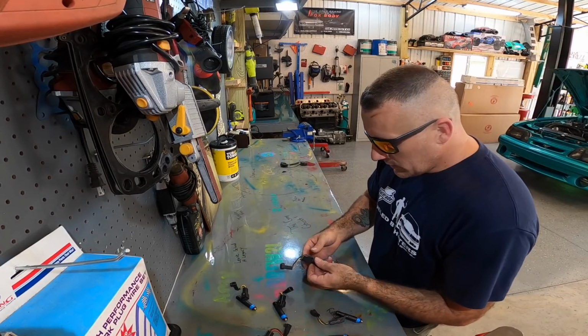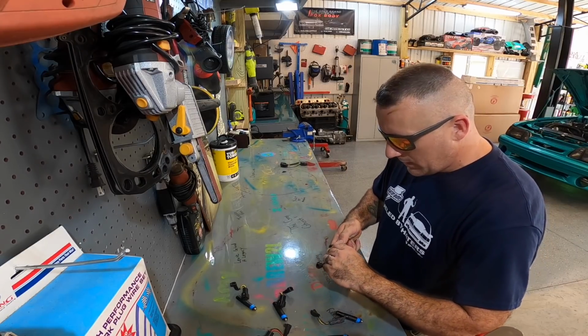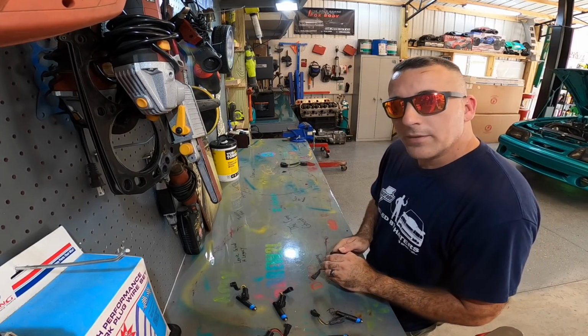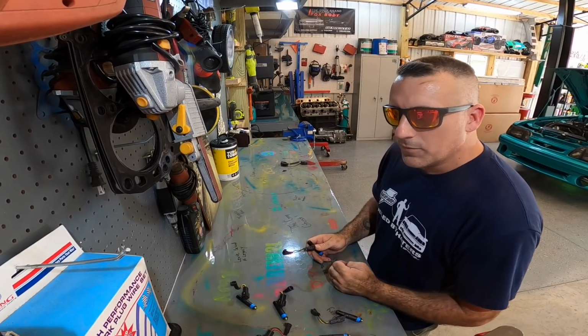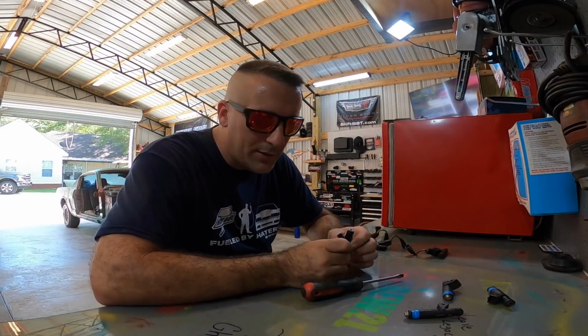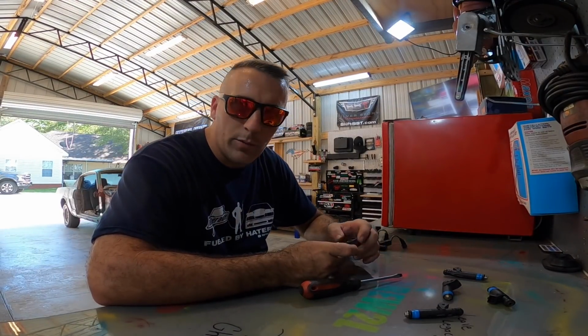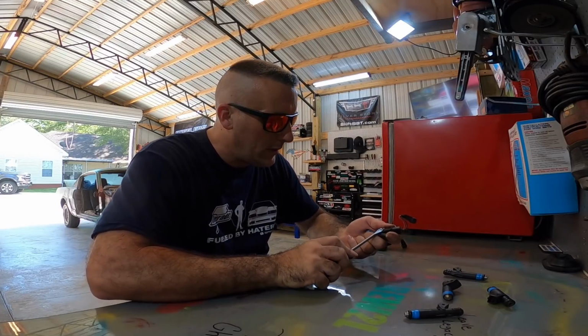So why are we doing this? Well, we have 60-pound injectors in the car right now. And if you don't know, 60-pound injectors are really only good for about 500 to 600 horsepower. It depends on who you ask. So what I'm trying to do here is test to see what injectors will work, how far we can push them, what kind of power we can make.